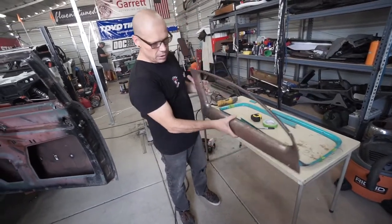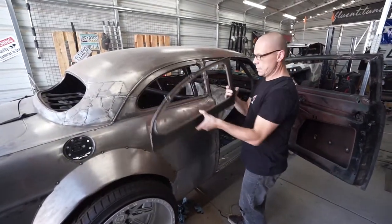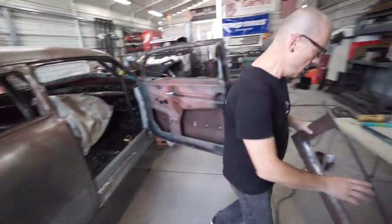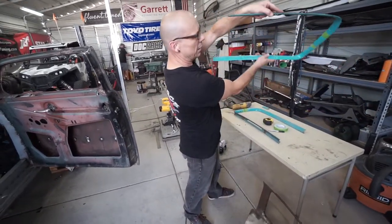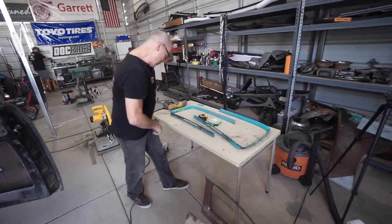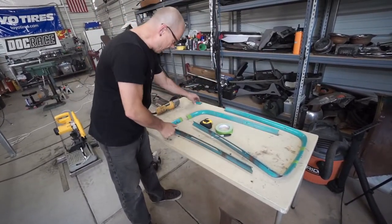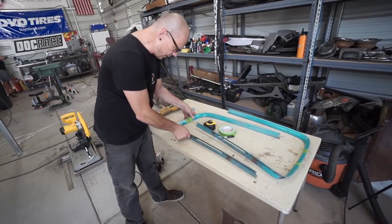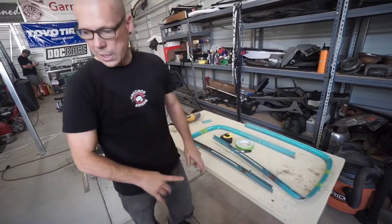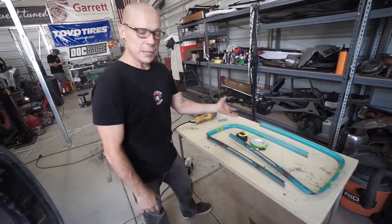While Ryan and Jim are working on the cage, I wanted to finish this front windshield trim. These are the side windows — back here goes on the inside — so we have to chop these four inches and shorten them seven inches because of what happened on this section of the car. The windshield has one as well, sitting like this on the passenger side. We need to chop it to fit the roof height, so I took a measurement and cut out a piece. Ideally when I tack it back together it'll fit the proper height of the A-pillars. I need it done to make sure we can get it in there with the roll cage in place.